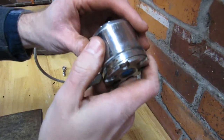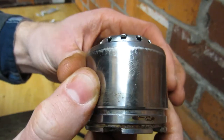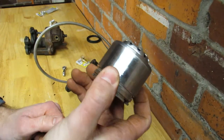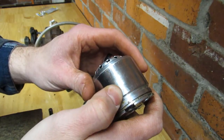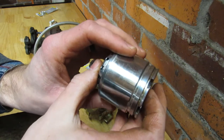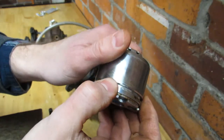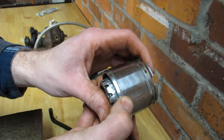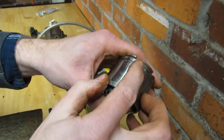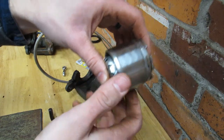Let's look closer at this piston. This one doesn't look too bad, but I'm confused by all that scarring. Remember this is a rebuilt unit, so it may have happened in a previous housing a decade ago. These are the kinds of things that'll start causing problems with the seals. You have to get it right in the light to see the rust pitting all in there. I've pulled some of these apart that are just covered with rust, particularly on the lowest point of the caliper. Water got into the brake lines, came to the lowest point in the system, and then it rusts out the piston. It happens.